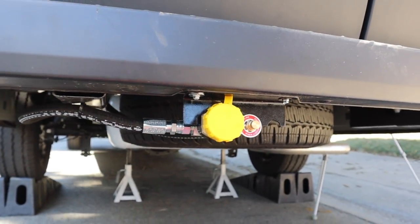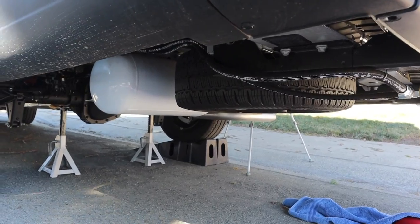If you've been following along with our build, you might have noticed last week when I installed the propane remote fill kit on the back bumper of the van. I have to admit, that was a mistake. If I were to leave the remote fill in that location, when the van ultimately ends up dragging — and it will, it's an extended — the rear bumper is a long way from the rear tires, so it's inevitable it's going to drag. That location would be bad for the remote fill itself and could be dangerous, because if there are sparks near the propane, that could cause a fire. So I made a poor choice in location and now I'm going to show you what I'm doing to rectify it.